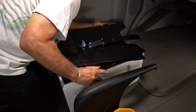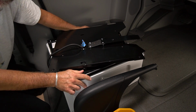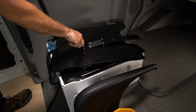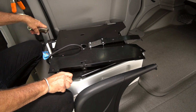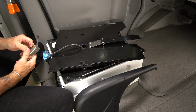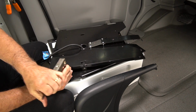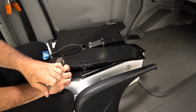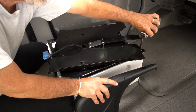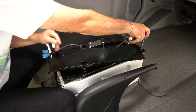Again, whoever mans the drill press over at this Sportscraft factory, they got to get him a pair of glasses or something, because this is not perfect, I'll tell you that. Holy mackerel. All right. I'm starting to realize that each swivel kit will present a different set of problems, mostly to do with the alignment of their holes with the existing holes. If you are lucky enough to have all the bolt holes line up, then loosely thread each of the 4 mounting bolts evenly until hand tight. Then tighten each bolt down to 20 pounds.